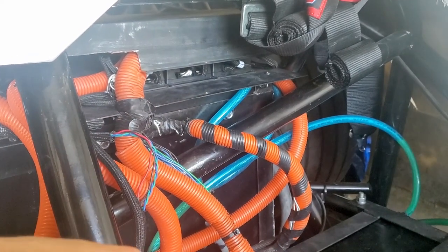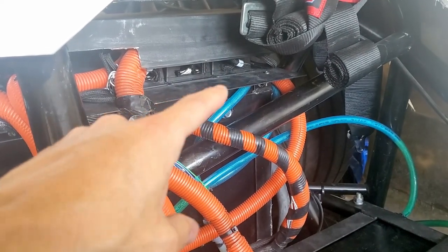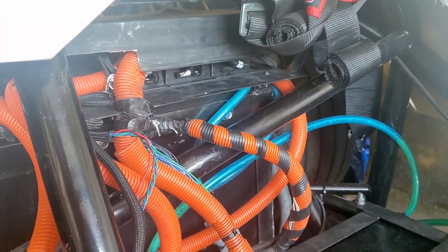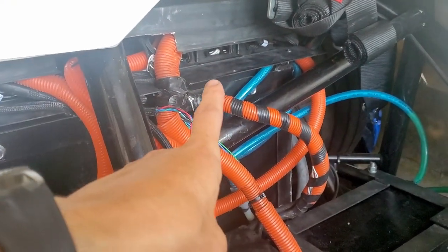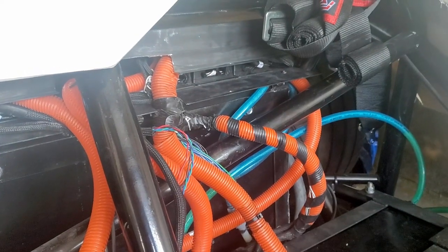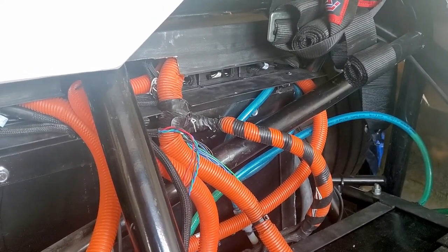It's just the BMS that's not good. And to confirm that further, I kind of swapped BMS units. They're just satellites, and so the problem followed the BMS unit, not the wiring. So my battery modules are good, my wiring's good. I just have a bad part of my battery management system. So I'll see what we can do. In the meantime, I'll probably just turn off that battery management system for pack one.